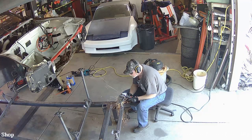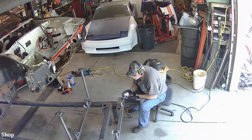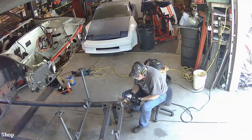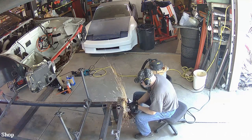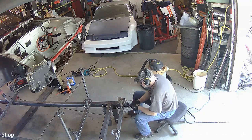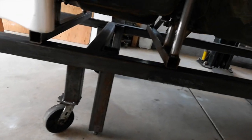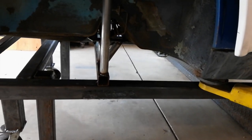After connecting all the attachment points, I found some sharp edges that needed to be ground off. You can see the strut attachment point sticking up high and the lower chassis points underneath. The process right now is building a jig off a known good body — I've got three-by-three tubing, two-by-two cross tubing, and inch-and-a-half tube going up.